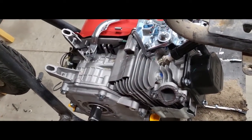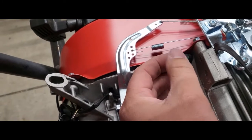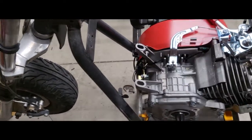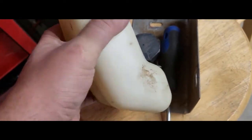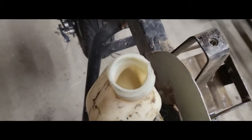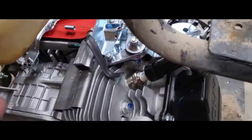So I'm gonna have to mount the plate up to get the engine to work. Now I gotta figure out what to do about the gas tank. There's a fuel line right here, so I might just stick a fuel filter on top and then run the fuel line up into the tank. The tank mounts sideways like this inside the simulated gas tank. The gas goes in there and then I can put the fuel line into the side, come out that hole right there, and run down into the fuel line.